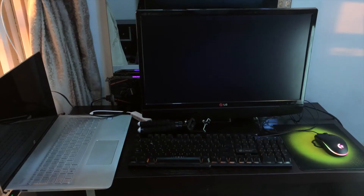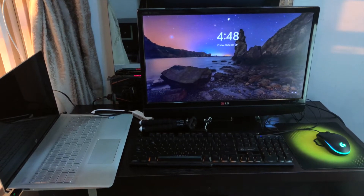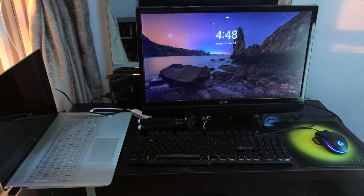When I was doing my own research, I found that HP in particular stopped doing this whitelist thing in their BIOS. From about 2015 onwards, there's no more whitelist — you can use any Wi-Fi card or device in that slot and it will just work fine. When my components arrived and I connected everything and set it up, it just worked flawlessly. All I had to do was install my drivers and it was up and running. Just make sure you do your own research for your specific laptop.